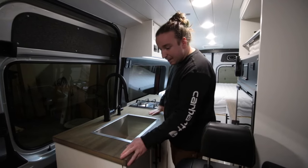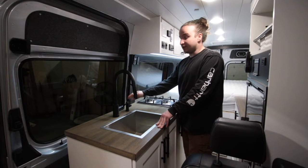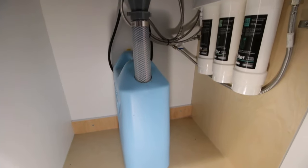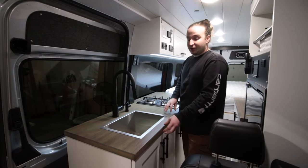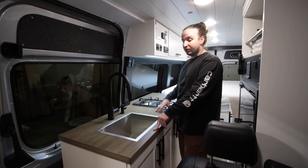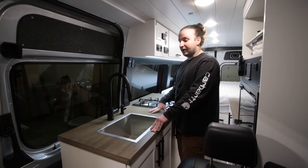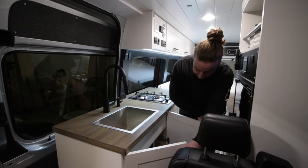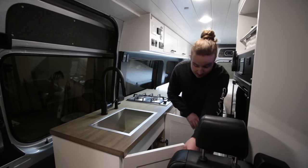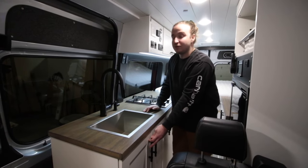Moving on to the kitchen — they went with bamboo countertops. I think wood countertops in this van look pretty good with all the white going on. They have the pearl stainless steel sink, the matte black pearl faucet, as well as the drinking faucet with three-stage water filtration. All their drinking water is filtered no matter where they fill up. The sink is top-mounted. With this type of wood specifically, under-mounting the sink is not ideal in our opinion — you get warpage down the road. Underneath there's plenty more storage, their water filtration, and their 20-liter gray tank. We still find that's one of the easiest ways for a gray water system.